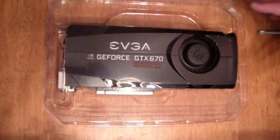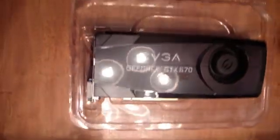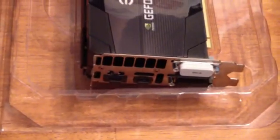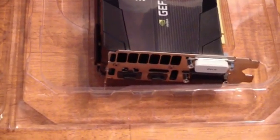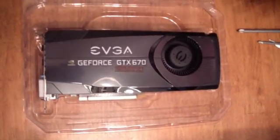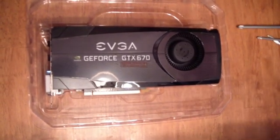It has a nice fan enclosure because the card stays fully encased so that the fan blows all the air out the back of your case and not into all the rest of your parts. That way you keep your graphics card cooling kind of contained. You might think of that casing as something that keeps it hot, but what it actually does is allow all the air from the fan to run over all of the components, which is a good thing.